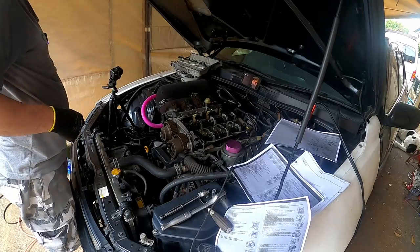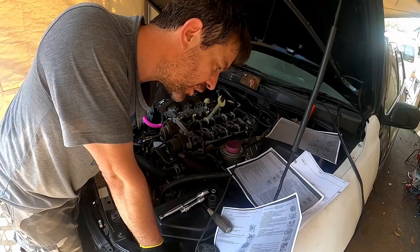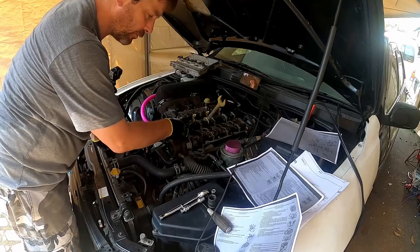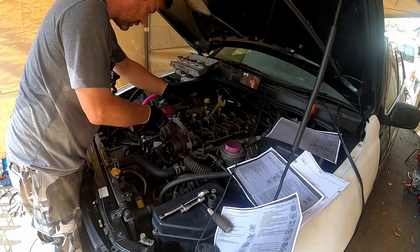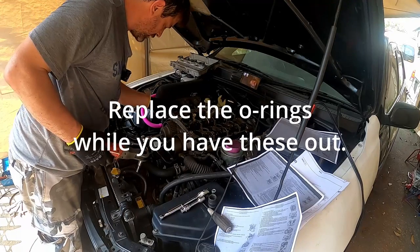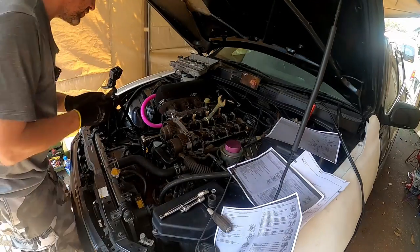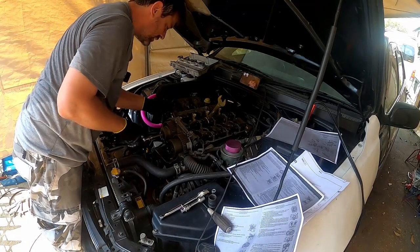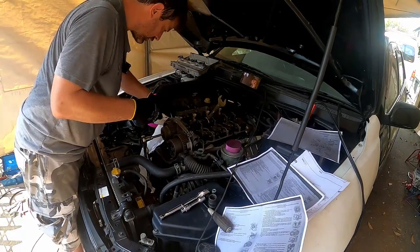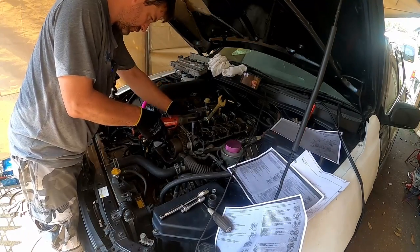Oh, just pain. Remove the bolts and remove the camshaft timing oil control valve. Okay, that's that one. And that one, I think. Get this out of here. How does that come out? Is it pull? Oh, yep. Oh, there's some oil. Excellent. It did say to make sure you have some rags handy, so guess what I didn't do? Rag city. Okay, we're all ragged up. Get the other one out.